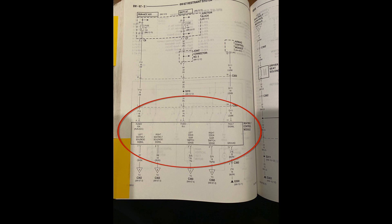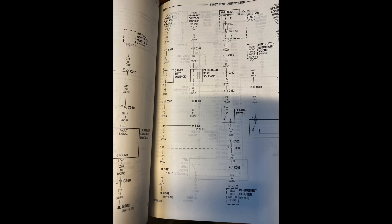The module gets input from both door ajar switches, and it sends 12 volts to solenoids to unlock the seat belts. It also sends a 1 to 3 volt status output to the airbag module, which in turn may send a signal to the cluster to turn the seat belt warning light on. The seat belt timer module gathers input from an inertial ball inside the module together with data from the door latches to decide whether to wake up and unlock the normally locked seat belts. It uses a timer function to put itself to sleep after 30 minutes with key off and doors shut.